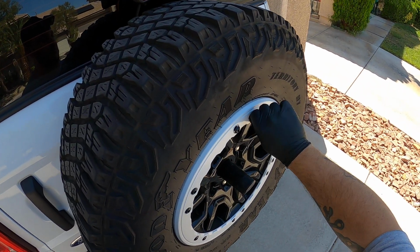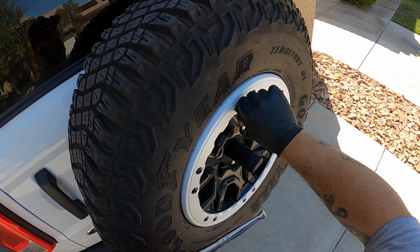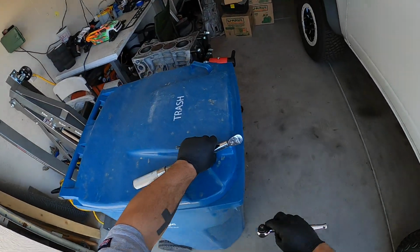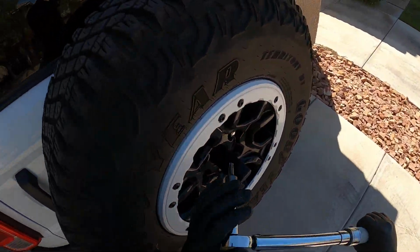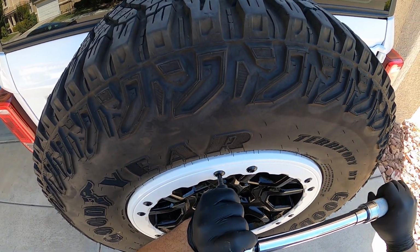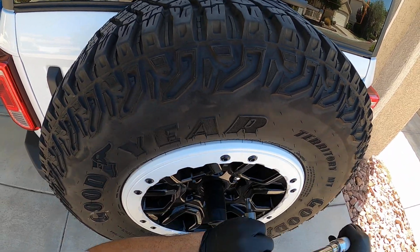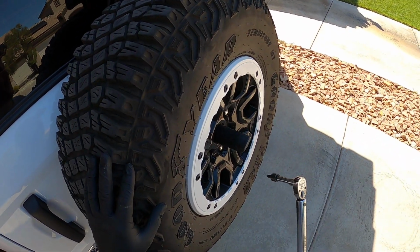So when you're taking these out, take them out the first time completely with the ratchet, clean all the bolt holes before you reinstall them, and I torque them to 20 foot-pounds. And you also don't want to hang on these things while you're on the wheel. It just doesn't take much. Again, you're putting a hard steel bolt in a cast aluminum wheel, so if you put too much torque on them, you will strip the wheel out.